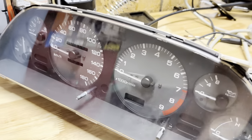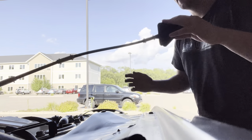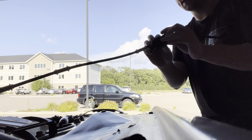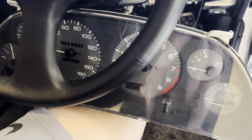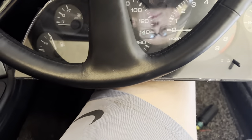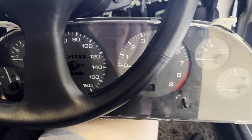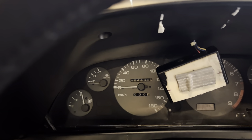I'm going to throw this in the car, go for a little test drive, and make sure everything works. I'm going to feed it in through the top of the car, and once I get it all the way through and get the piece mounted I'll do it at the bottom as well. I got it fed in — I'm going to slide it into that little slot there. Before I fully put it in, I'm going to test mine. Basically remember to re-plug in the harnesses back into the cluster. I'll spin the other end that I haven't connected into the transfer case yet and see if the kilometers work.